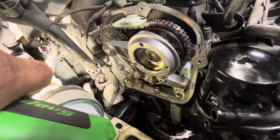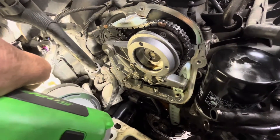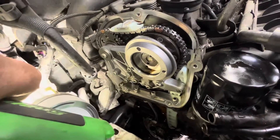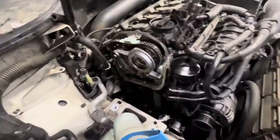If it's a two-liter and it's starting to run kind of rough, and you check cam phase position and it hasn't had the updated chain installed already, and you're seeing four, five, or six degrees of negative value at that camshaft phase position — you're going to need a chain. I appreciate you watching, thank you.